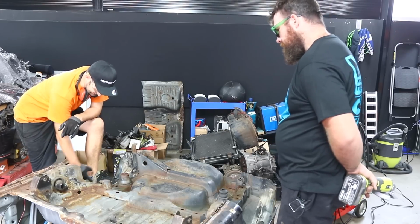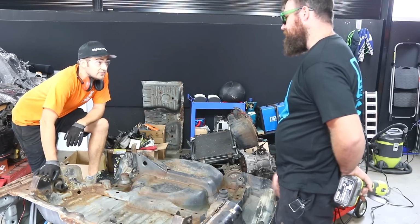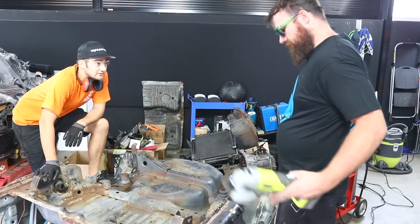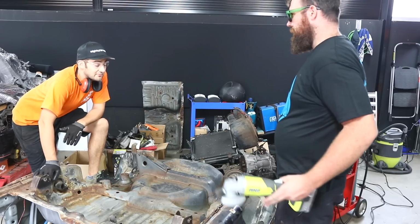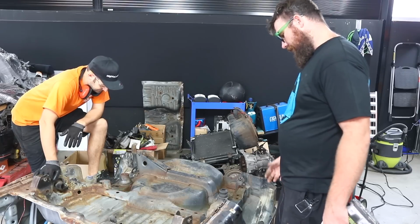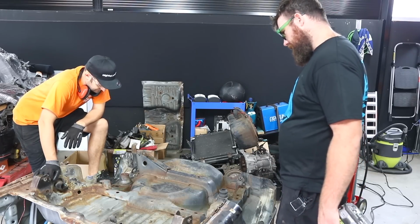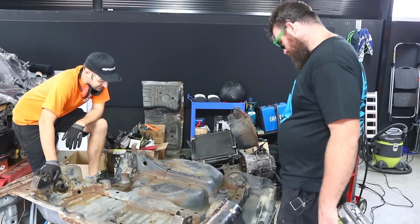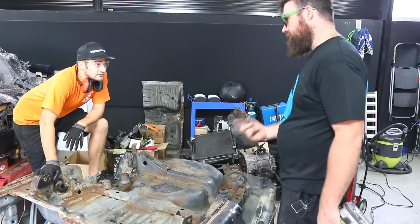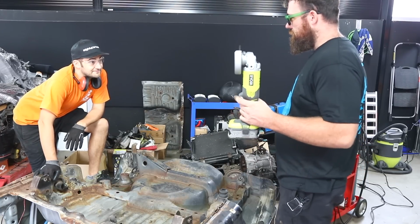of these are from inside the wheel. Yeah, they're sort of inside a box section that you can't get to because the car is assembled in stages and they don't put a whole floor pan in the car. Yeah. Like they actually build the external onto the floor pan, whereas we're sort of trying to go backwards. Yeah, okay. So I think in this instance, we'll actually cut the body away and get it to a state where the factory would have had it assembled in that sort of sequence. Cool. And then we'll have to do the reverse when we do the mirror. We'll cut the floor out and then basically grind to the seam and then drill the spot welds out that way. Cue the grinding shots and upbeat music.